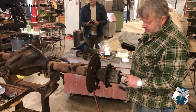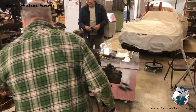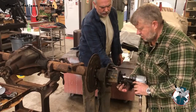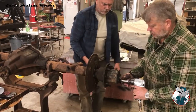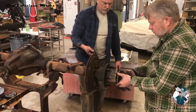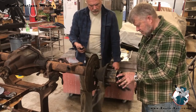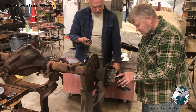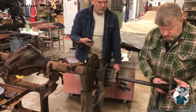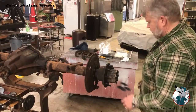Okay, so that's all the brake components, and now we're just going to take this axle housing off and get the backing plate. We pull these out and the axle just slides right off — that's another 9/16ths. There's a little aluminum washer on this, and then this axle just slides out of there. We slid it back in a minute ago so we can sandblast it without getting grease in there.